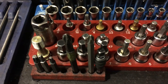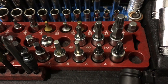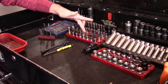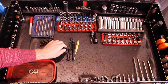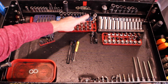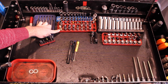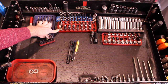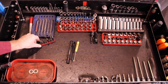Back here are my quarter-inch drive T20, T25, and T30 sockets, as well as several Allen quarter-inch drive sockets. I have some triple squares, a spark plug socket, a couple of 1/4-to-3/8 adapters and a 3/8-to-1/4 adapter. Down in the front are two Torx bits I use mostly all the time: T30 and T45, and then 5 through 10 millimeter Allen bits — 5 and 6 are Snap-on, the rest are Craftsman. And this is a 14x1.5 thread chaser, which I use for chasing threads on drain plugs on almost all of our cars. When the plug doesn't come out right, I chase the threads and if needed replace the drain plug.